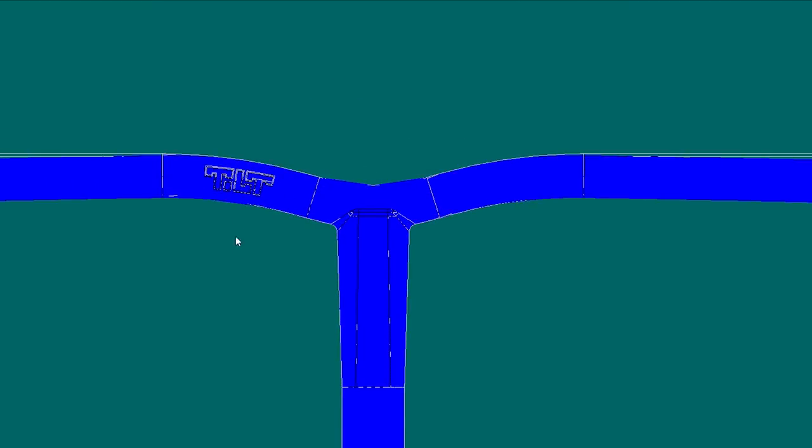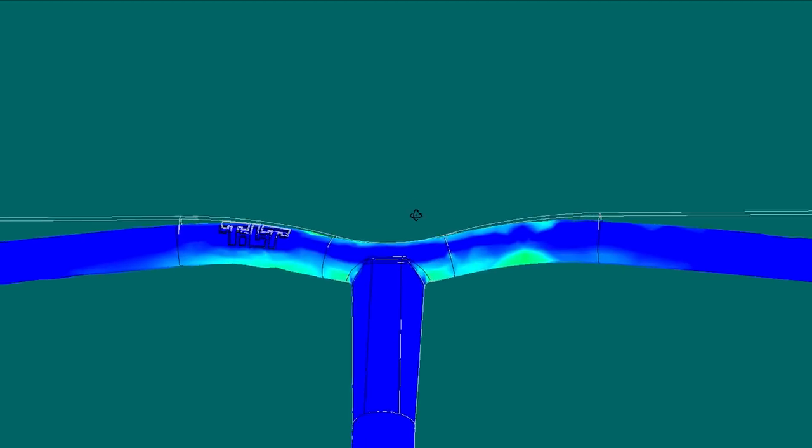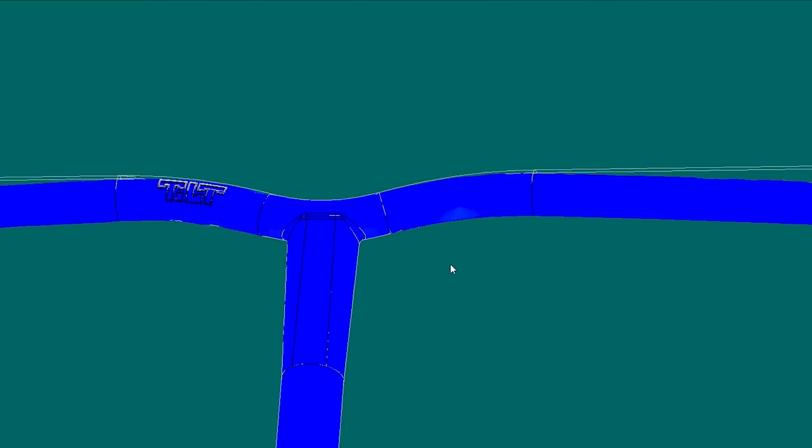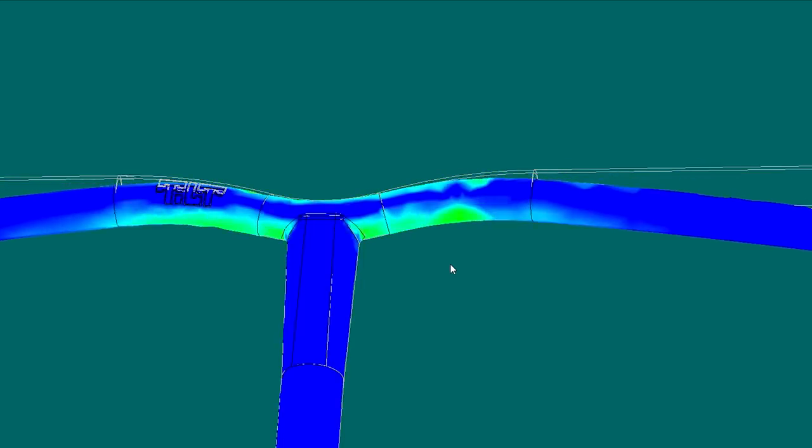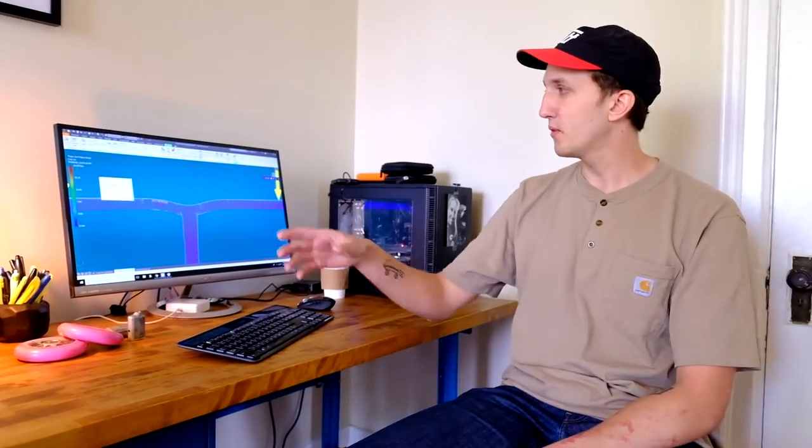That's why the hybrid bar has a super smooth cross tube, and looking at the simulation here we can see there's a more even spread of the stress — there's not just one weakness. Combining this with the heat treat process that we do for the scout bar, we actually offer this bar with what we call our thrash resistant lifetime guarantee, which is essentially a lifetime warranty. This would be a really good option that I think a lot of people should check out because it's a really strong bar, likely a lot stronger than what many people are riding.